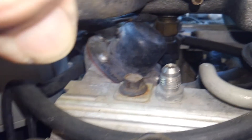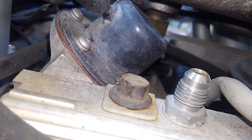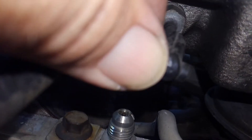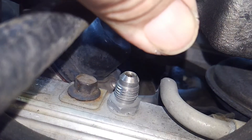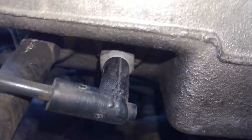The first port I just removed is the easiest to see. This controls the diaphragm inside the fuel pressure regulator — a spring-loaded diaphragm inside that bell-shaped housing. Your fuel pressure as it comes through the line is going to be a little bit higher than what the system needs, so this was their way to control it with a constant vacuum signal from the engine. It brings it back down to around 42 to 44 psi. If you get above 50 psi on your tune port fuel pressure system, the engine will run really badly. So that first port literally controls your fuel pressure through the fuel pressure regulator.